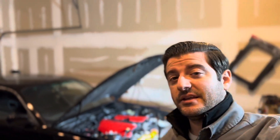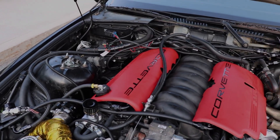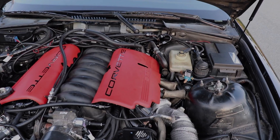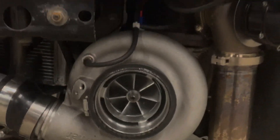Welcome back. This is my BMW E36 that I have Turbo LS Swapped, and I have a Holley Terminator X as an ECU inside the car. It's an LQ4 with a 72mm Borg Warner Turbo with a 6-speed transmission — I absolutely love it. The turbo in this car is a Borg Warner SXC 372 with a 1.00 AR hotside T4.